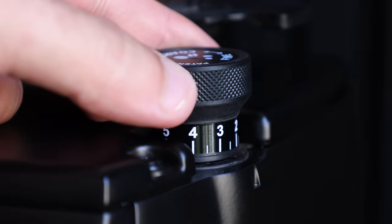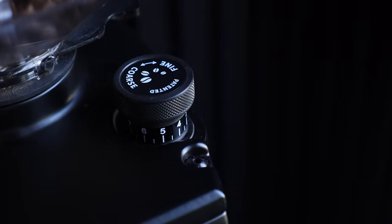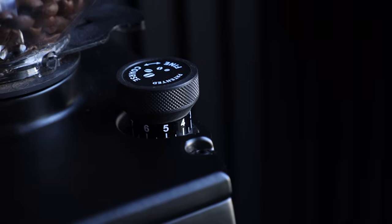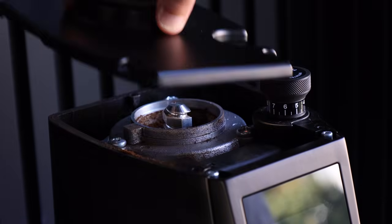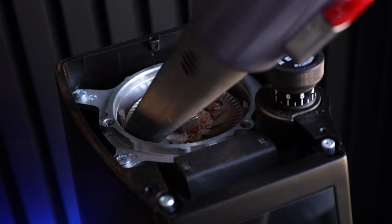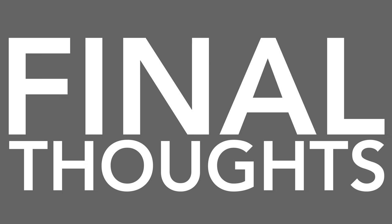Also speaking of grind changes, the adjustment knob is still just a little too small and it can be easy to lose your dial-in if you swing over in either direction. They did at least add some arrow cues for finer and coarser. Finally, and somewhat predictably given it's an issue I've brought up with most Eurekas I've reviewed, getting inside to clean it up is more time-consuming and tool-heavy than most other grinders on the market. It's not difficult, but there are a handful of steps, and since the burrs and motor are on an open-sided platform, you'll need canned air or a small vacuum to avoid brushing grinds into the body of the grinder.